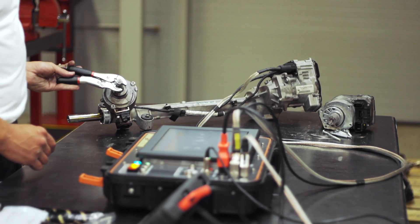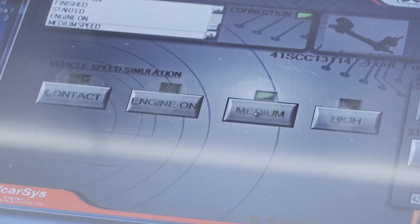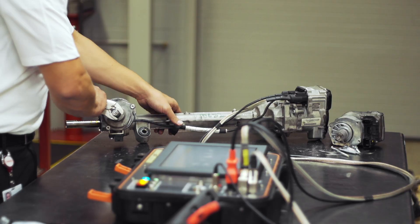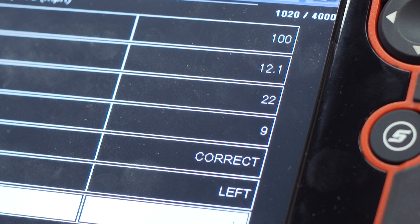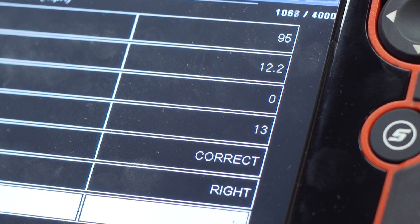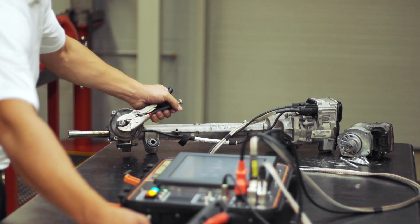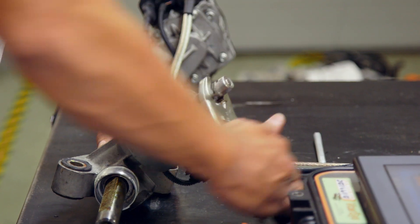When reviewing the data and turning the pinion, you can see all the values are responsive. The amperes are reacting to the current consumed by the motor and the torque sensor is signaling left-to-right intervals while providing torque values and angles in degrees. The test confirms that the electronics are communicating and the core is functioning. As previously recommended, the mechanical components should be inspected for defects and sealing components should be replaced. The rack should be tested under a load to ensure reliability and performance.